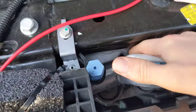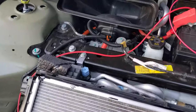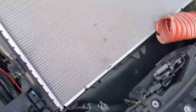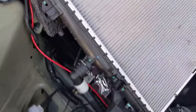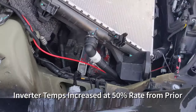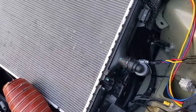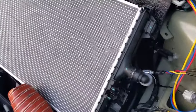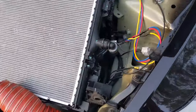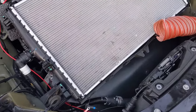The AC compressor is right about here and can spin up to pretty high RPMs. It's a fairly effective heat exchanger, and if you're not going on track it's more than enough for normal driving. But obviously we need more capacity than that. The powertrain radiator we added in has about six times the capacity of the stock radiator. This dropped our drive unit and inverter temperatures pretty significantly. We saw a large drop-off, but the oil temperatures were still high, stator temperatures were still pretty high, and rotor temperatures were high. When you have a permanent magnet motor, you also have to be pretty cautious of the magnet temperatures. All of this is fairly well limited by the electronics in the car, so there's no risk of hurting anything from the factory — but you end up exceeding those temperature limits fairly quickly.